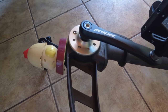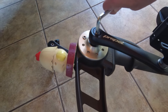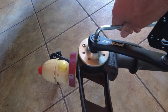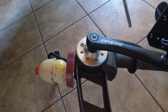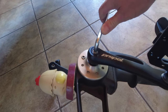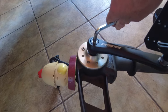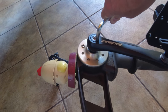I've been hearing a lot of people complaining about their pedal drive squeaking. The first thing you have to check is both of these pedals — make sure they are on very tight. Native Watercraft suggests 26 foot-pounds. I'm going to link a video from Native Watercraft where the guy shows you how much 26 pounds is. Mine were actually squeaking; I thought I put them on pretty tight but they were not tight enough. I have a torque wrench and I got it right about 26 and a half.